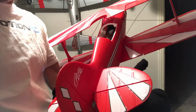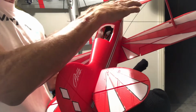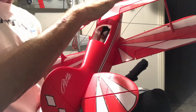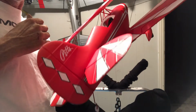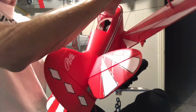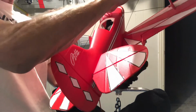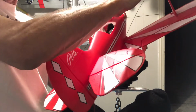But if you got the controller into a right turn or a left turn, then it'll get to a point to where the aileron starts flattening out. It's fighting it, but it's still flattening out. So the more that you move the stick over, the more that aileron starts flattening out. Not trying to turn, but flattening out. Okay? And when you're moving the plane up like this right here, you're turning it on its side. And when you get that stick over far enough to where that aileron is flat, then that's the highest angle of a turn that you're going to be able to make with that gyro on. Now, in Safe, you can do whatever you want, but in the AS3X or whatever kind of gyro you got, it's going to do that.